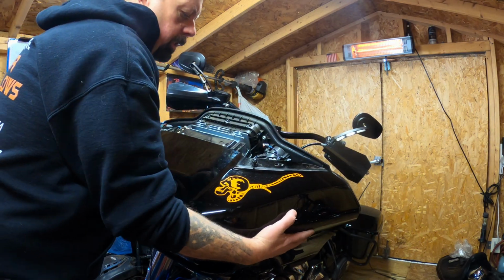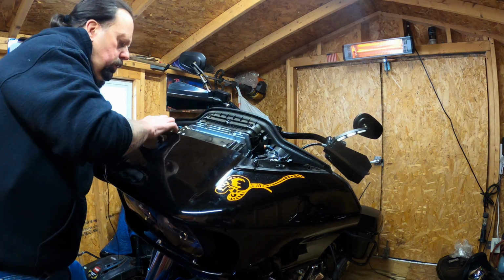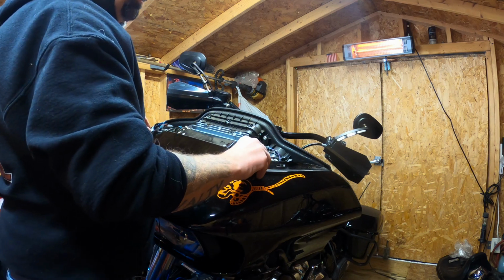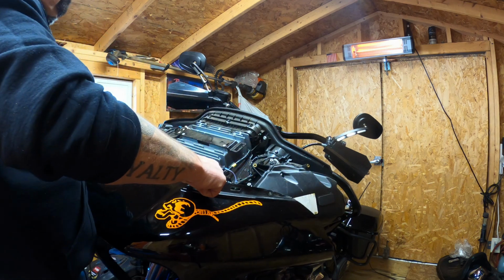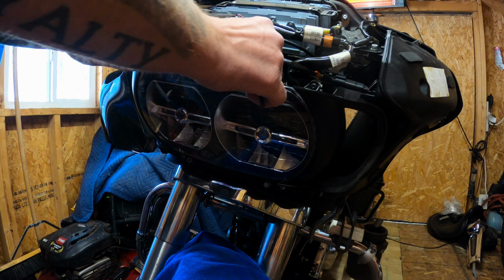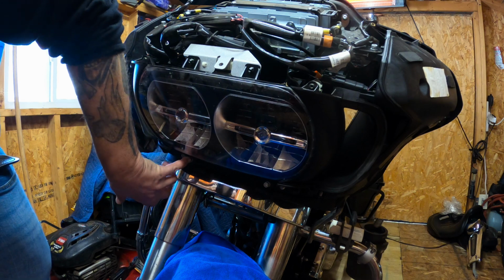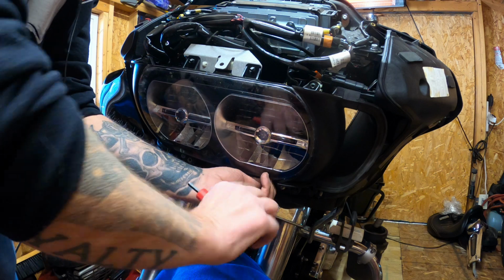You could loosen this up. Okay. You still have your 2 screws here, so it's going to drop down without it. So pull the 2 screws. And gently lift away. Okay, for the headlight, you got 4 bolts to remove. 1 here, 1 on the other side, and 2 on the bottom. Once you get that last one out, make sure the headlight doesn't come crashing out on you.